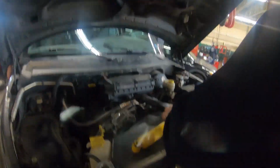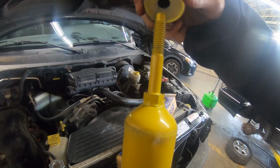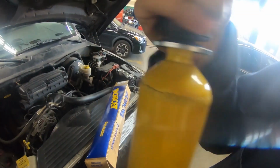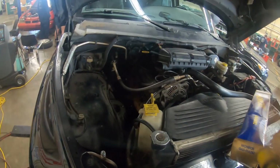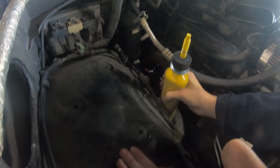So first thing we're gonna do before we even drop the shock down, put our retainer and our lower retainer and lower grommet on first. Make sure that's all the way down on there. It's nice and sealed. Then we can drop the shock in. Coming down to you with it. I'm blind, so just kind of guide me down.